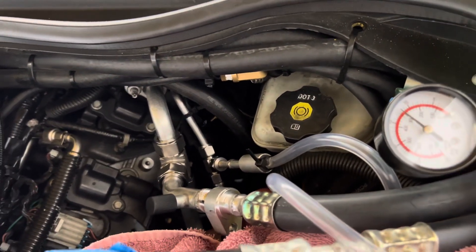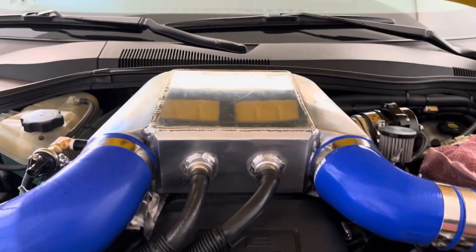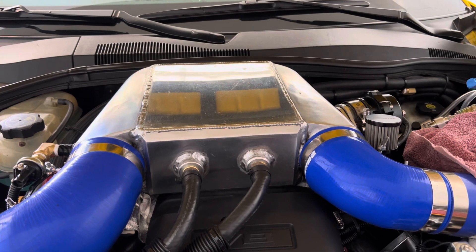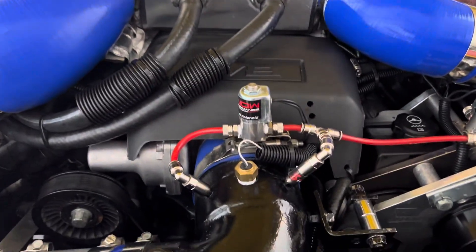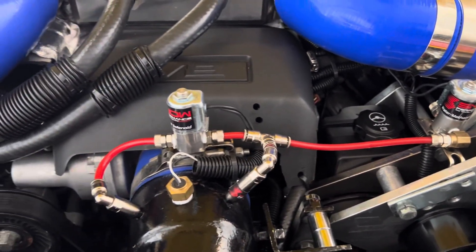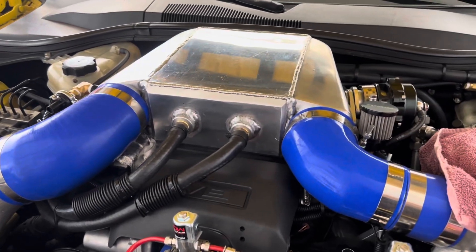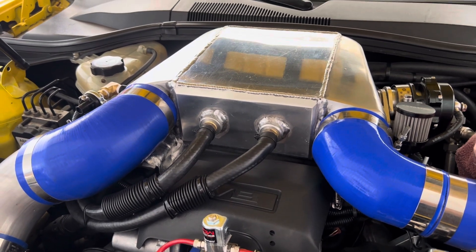Then I should have a follow-up video of this thing actually working. All the lines to the liquid intercooler are ran underneath the car. You're looking at roughly 18 gallons of fluid — it's an alcohol and water mixture right now; I'll probably switch back over to antifreeze depending on how it behaves. This is just an example of the Stage 2 Snow Performance methanol system. We'll keep you posted as the next video comes up, but this is my knockoff version of an interchiller or cold tank system — see how it goes on Tuesday once we charge it.